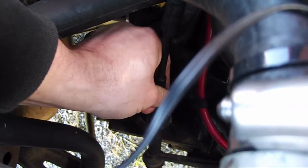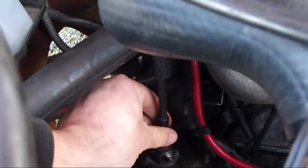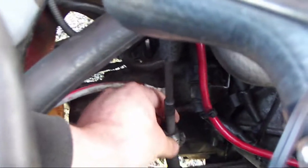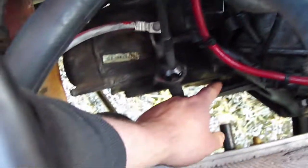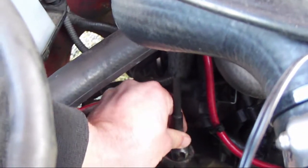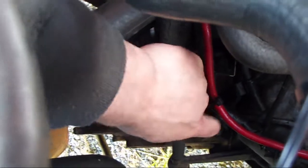Check it — you've really got to get a feel for it. When you pull the cable itself like that, you're checking for how much play is between the lock wheel and this bracket over here. This connects to the clutch fork which goes inside the gearbox and connects to the pressure plate. That's where the clutch fork connects to.